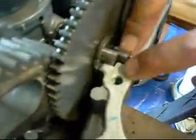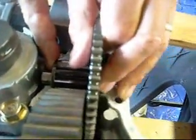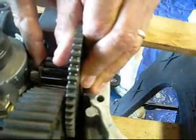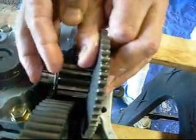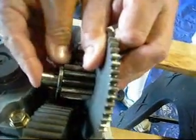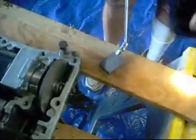Next, we're going to remove the center gear. The orientation is the slotted end of the pinion goes there. This is round on the top, so I'm going to assume that doesn't matter. Wiggle that out of there. Next, I'm going to remove the brake shoes, which are these pieces here. According to the wear, you can see which orientation they'll go back in.